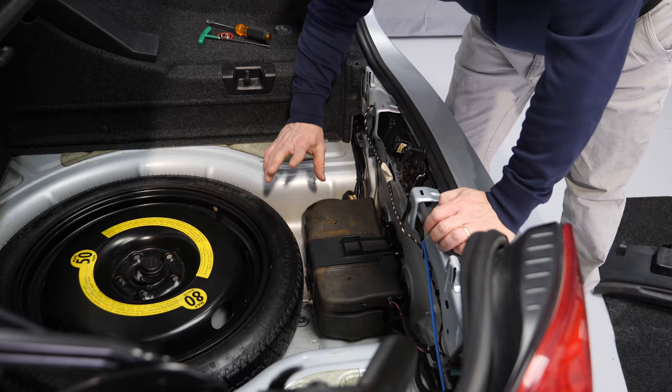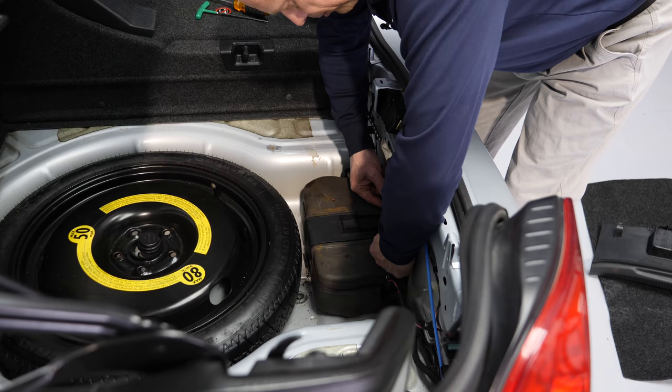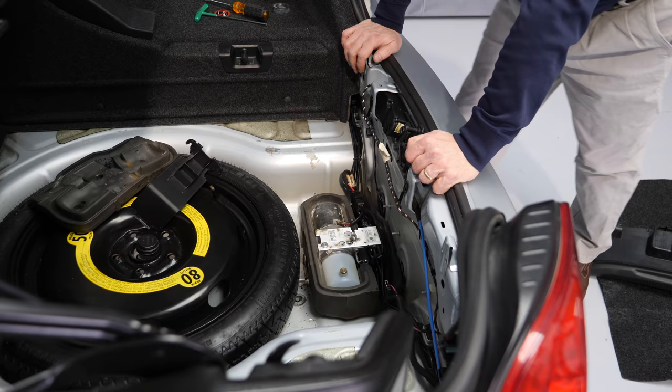Here I take out the rear trim panel and now we are almost at the pump. There is another plastic bracket on here that we can pull up on — it has two little release tabs in the rear. You pull those tabs forward, then push down on it and get it out of the bottom mounting bracket. And lastly we take off the foam cover and finally see the hydraulic pump.